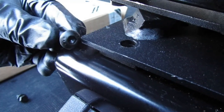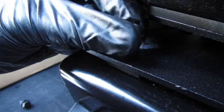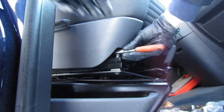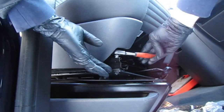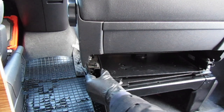The new bolts have an allen key head, which means you can tighten them well — but be careful not to overtighten them, as you really don't want to strip the thread here. Once you've tightened the bolts on the front, move to the back.